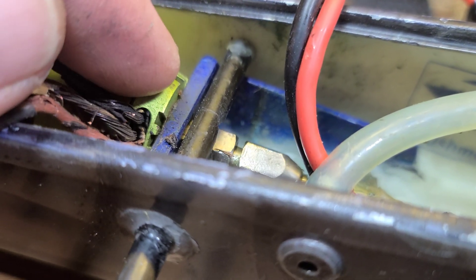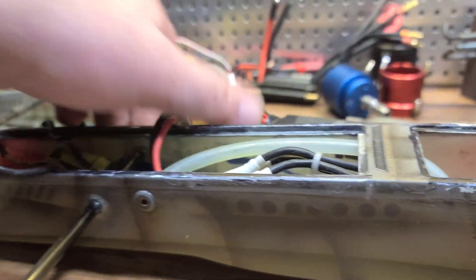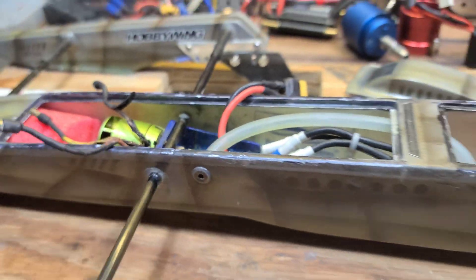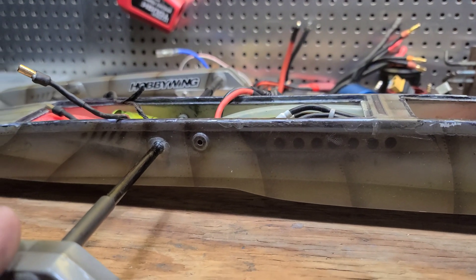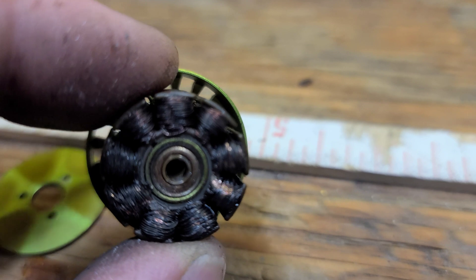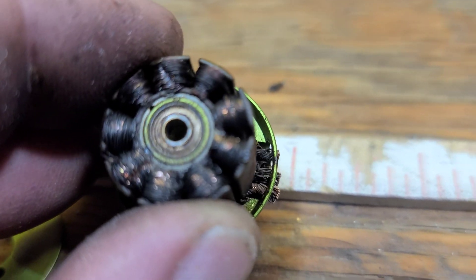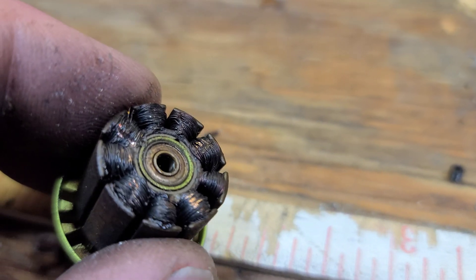It's really not set up for an outrunner motor because I don't have a water cooled motor mount. If you're gonna run an outrunner in a boat, you should use water cooling. These mini riggers, you could run one with an outrunner motor with cooling fins on 2S — a lot of times you can run them like that. I've run this boat several times, run two sets of 3S packs through it bone dry, and the motor didn't heat up like it did today. I would say it is toast — I've never ever heated a motor up that bad. I've gotten motors hot before, but I've never heated them up so bad that it turned the windings black.